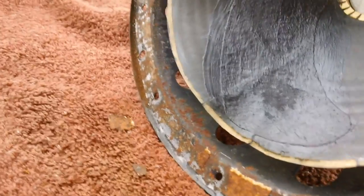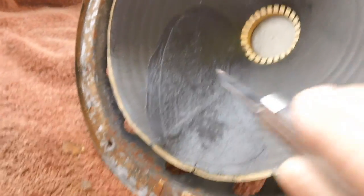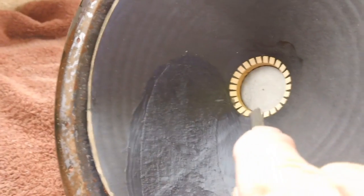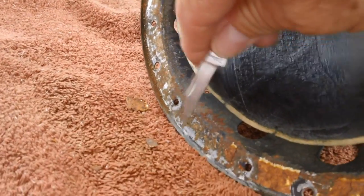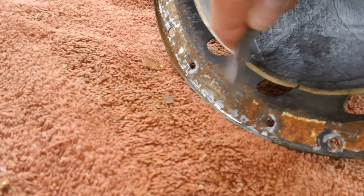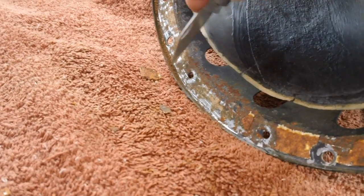Make sure the speaker is down at the bottom. You don't want to be scraping this with the speaker facing upward because a lot of the dust and crap will get down in here where the voice coil is. What you want to do is have it down like this so when you scrape it with your knife, all the stuff falls out on the towel as you go. Take your time. This is just the first crud removal procedure.